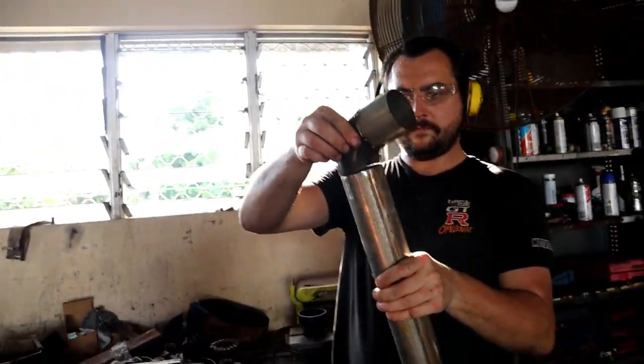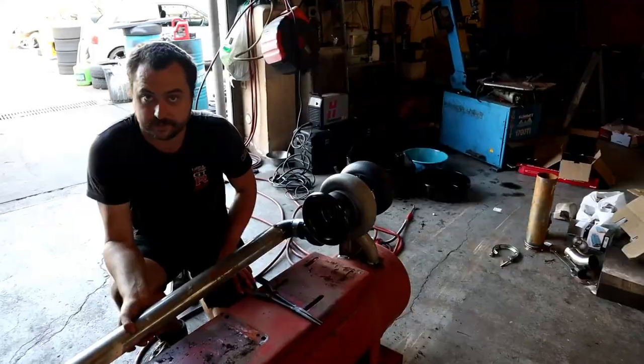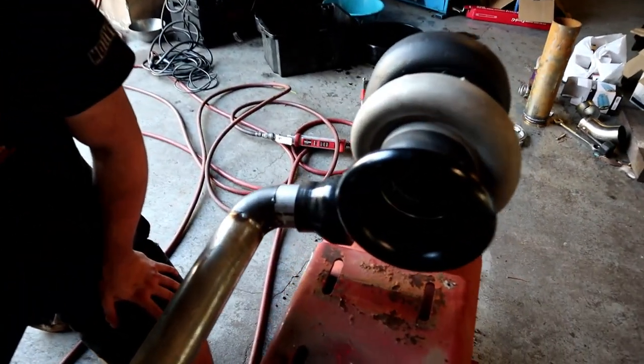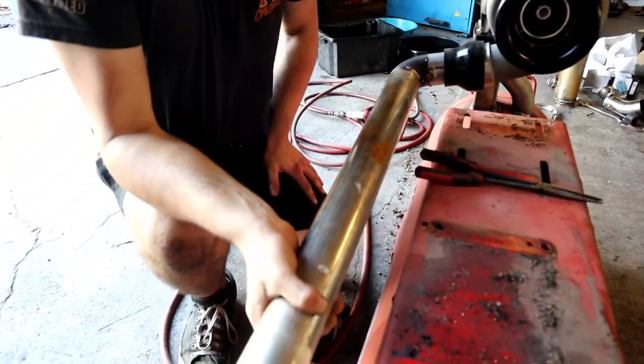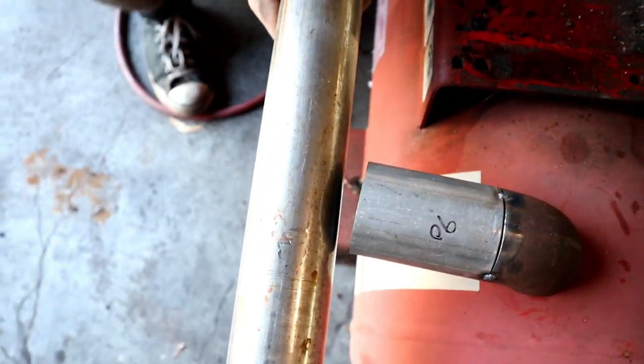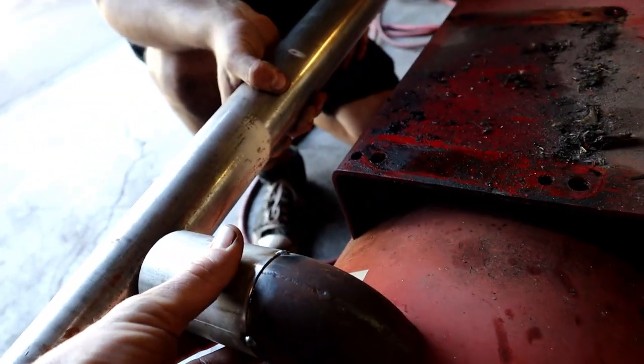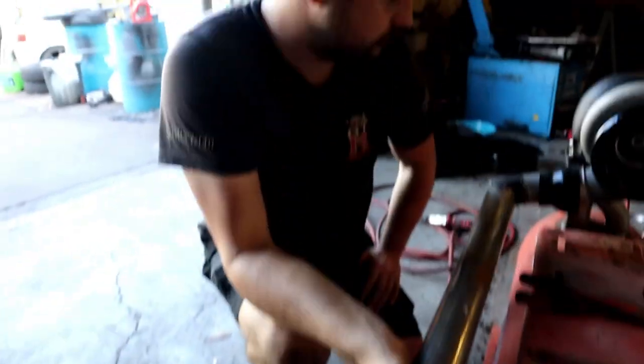That intercooler pipe. It's going to be hectic yellow. Aye, it's going to be good, eh? So that's pretty much our intake pipe, isn't it? Yeah. So I'm just going to have to cut it here somewhere and then put the 90 on and then chop a big hole out here. Tack it all together and then...